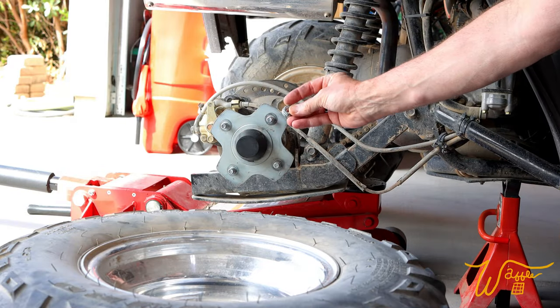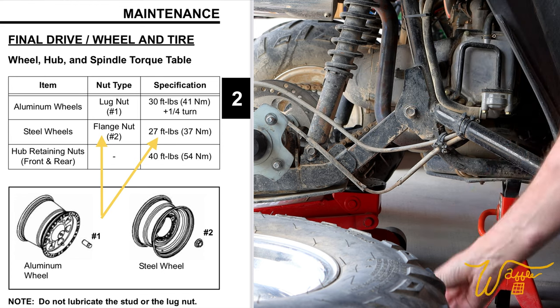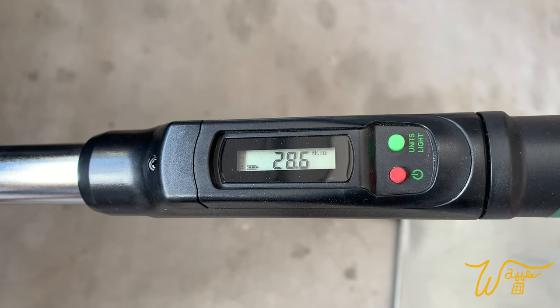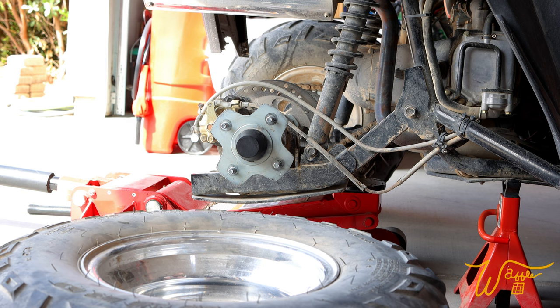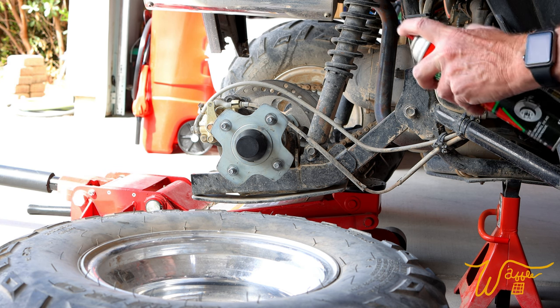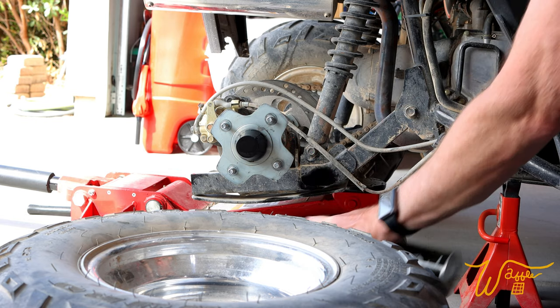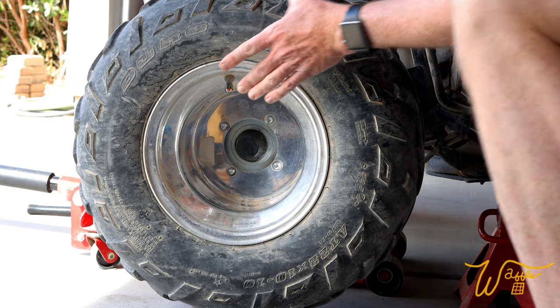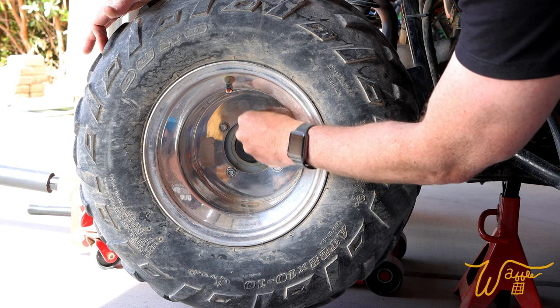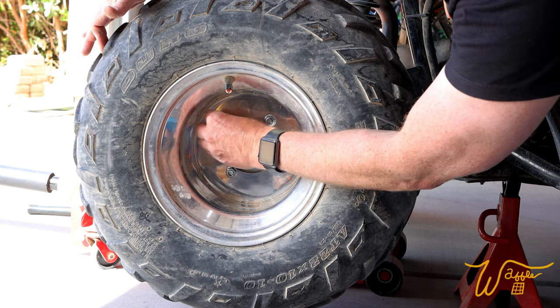The manual says when using flange nuts you should torque the wheels down to 27 foot-pounds. I dialed in my torque wrench to that setting. That same note also says not to lubricate the lug nuts or the wheel studs, so since I used oil to help get them on, I'm going to take some brake cleaner and clean all that off. A couple of videos I watched said these OEM wheel studs are pretty soft metal, so I'm going to forego the impact wrench and do everything by hand at 27 foot-pounds.